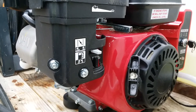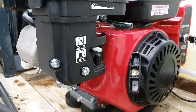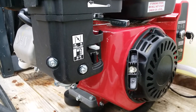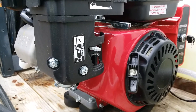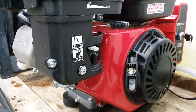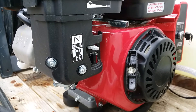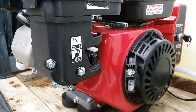If you plan on building this, do not try to buy the Honda kit with the electric start because it won't fit. Everything will fit on here — everything is from the Honda engine except for the actual flywheel. The flywheel is a Cola flywheel; I will leave the link in the description. It's the only flywheel that will actually slide directly on the Predator 212 engine.